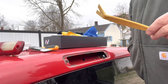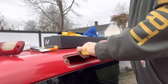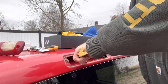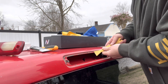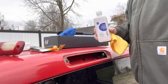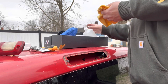You may need to get a trim tool to kind of pry it out — mine was in there pretty good. What we want to do is clean this surface here. If you've got a flat trim tool you can peel the old gasket off. Make sure the new one seats in there pretty good. Then I'll take some alcohol and a microfiber cloth and clean that area really well so when I put my gasket on there I know it's going to stick to the surface.